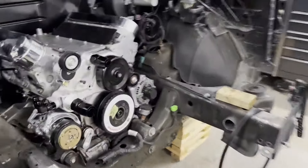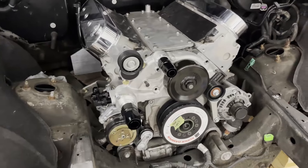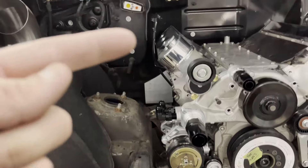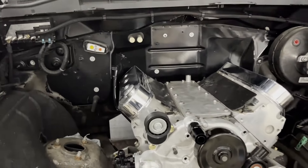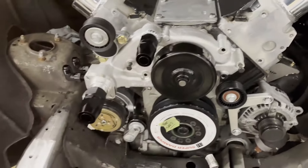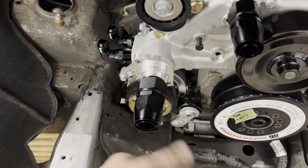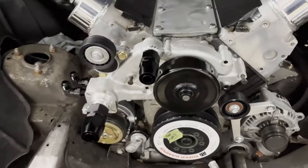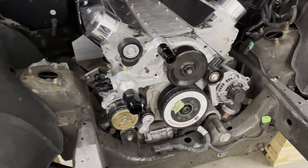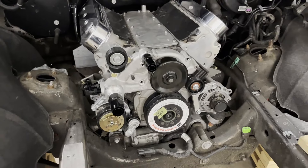That's going to end it off for tonight because I'm tired. Pump's just back on quick — you can see how tight these fittings are going to be. That's a dash 20 hose on the lower, dash 16 on the upper. I think the radiator sits about here, so I might have to run a dash 30 off the rad, and I'll probably have a 90 going straight down out of the radiator. The mid plate still needs to come out, but good progress for tonight.